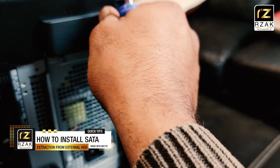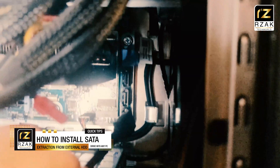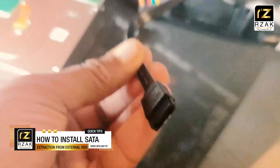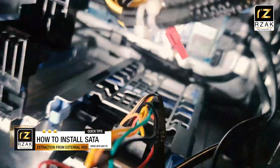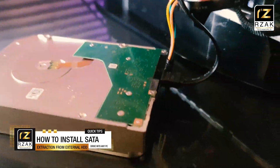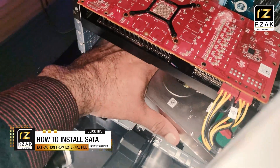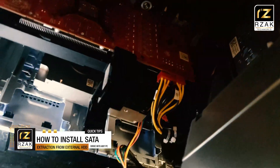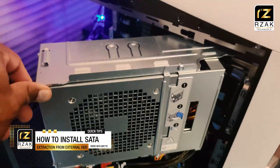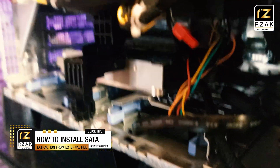In my case, I opened my Alienware R11. I planned to install two SATA drives on my PC, so first thing I did was to locate the SATA drive ports on my PC's motherboard. I connected the SATA connector to the motherboard on one side, and connected the SATA cable along with the power supply input cable to the SATA drive. Find a safe spot to put your SATA drive into your system. The R11 does have a space for putting extra peripherals — I found the spot at the bottom convenient and safe. Please make sure your cables are not hindering the case or GPU fans and not touching any part of your motherboard. Secure your hard drive properly into the enclosure.